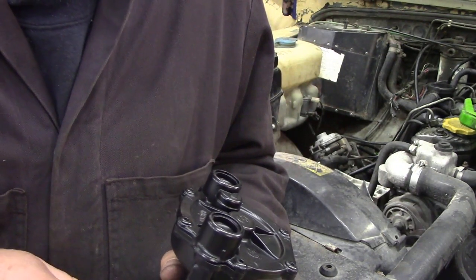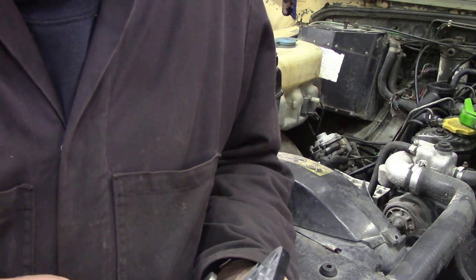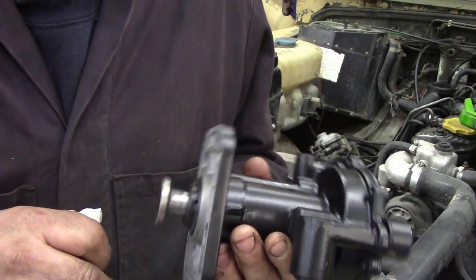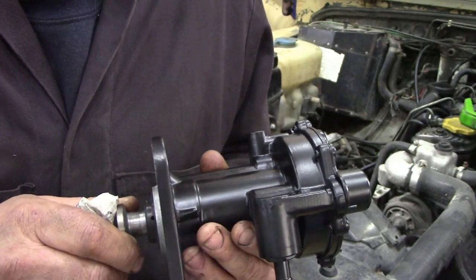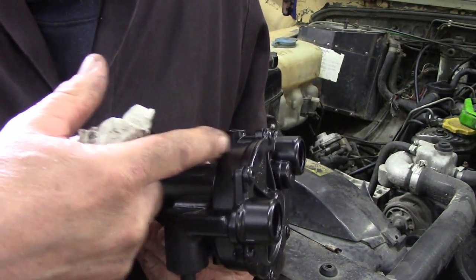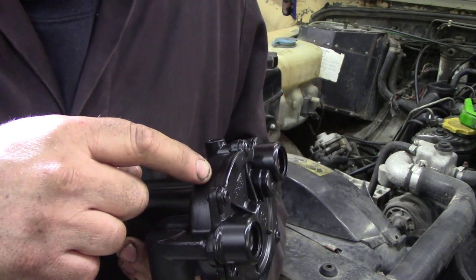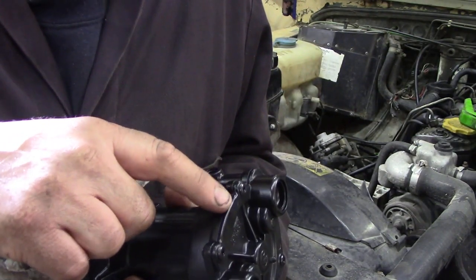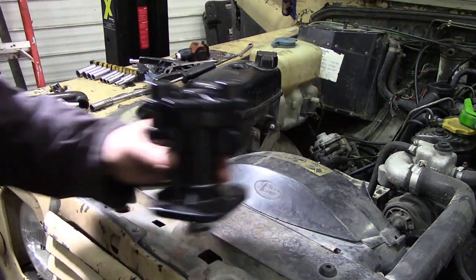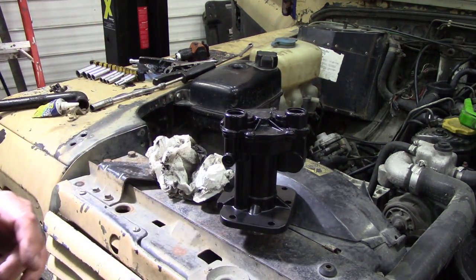I like to replace these with two gaskets. Unfortunately the gasket that's already on the vehicle is still pretty good, so I don't like doing it but I've got no other choice. I'm going to clean off the old gasket as much as I can, put some sealer on both sides, and then fit this. The reason for fitting it is it reduces the stroke ever so slightly and prolongs the life of the pump - there's a piston banging up and down in here and I have a feeling that tolerances, once the pump gets a bit warm, start to hit the end covers and that's why the rivets come loose.